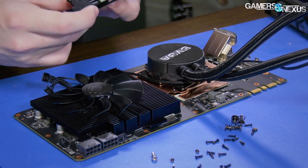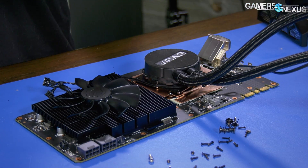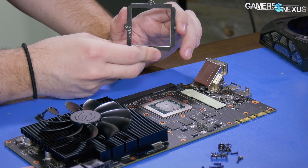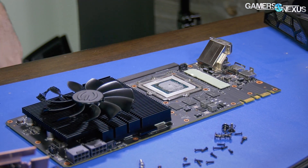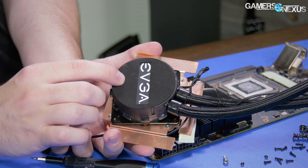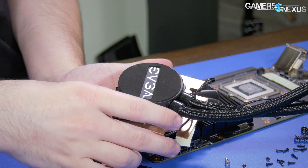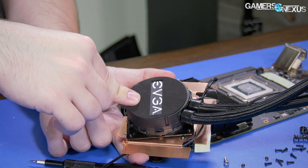Let's get rid of this. Small thermal pad for two FETs. And this plate is new - I don't think I've seen that before. This is what those four screws on the back center are screwing into now; previously they had screwed straight into the plate. There's foam on the top to theoretically help with noise damping - EVGA has had some pump noise complaints in the past. That'll help some of it. Most of it would just be lowering the pump speed to like 90% PWM, which you can do if you plug it into an adapter and then plug that into your motherboard. So if you've ever had that problem, that's how you can fix it.